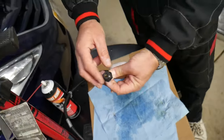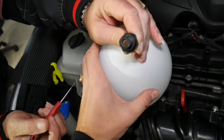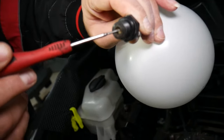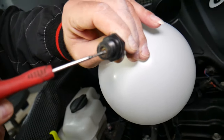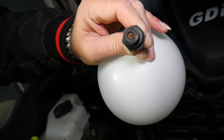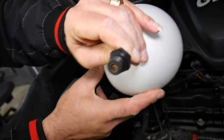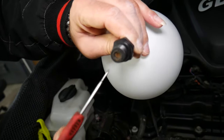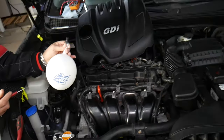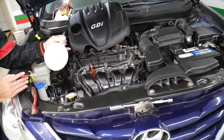You will need to replace it, and we'll put the link in the description below where you can get a new one. When we inflated the balloon further, we found that the internal ball is not centered — it's broken on the inside. If we bring it to center, it prevents leaks and works correctly, but the moment it shifts to one side it starts leaking. The PCV valve should be self-centering, and in our case something's broken inside. That valve needs to be replaced. If you want to see a specific video for your car, leave a comment below and if we have time we'll make that video. Thanks for watching and see you guys next time.